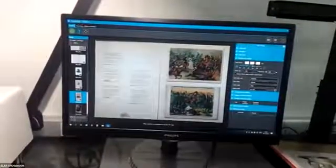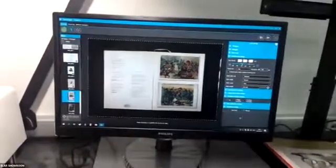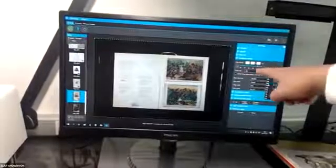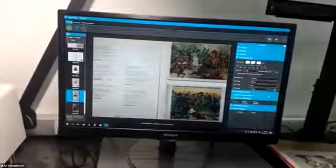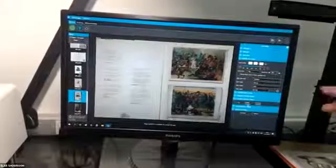Now you can select the format you are scanning. The scanner automatically changes the optical zoom, and most important, you see in the window the output resolution. This is an interactive process. So you are changing the format. You can define the format in DIN units. You can define the format in millimeters, and yeah, why not inches? But yeah, it's Russian tradition, the metric system. This is okay for half of Europe.